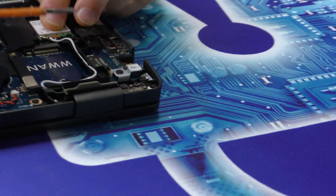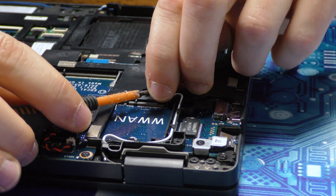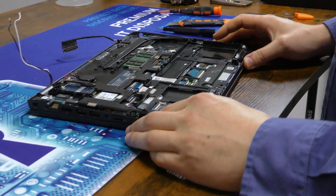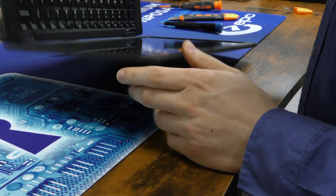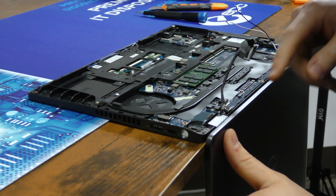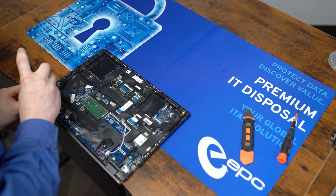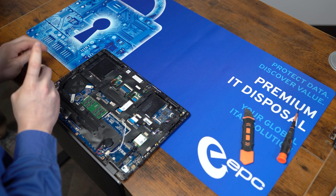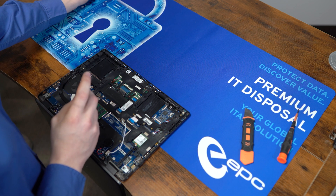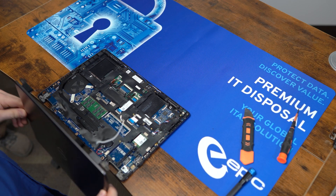You'll have to disconnect the Wi-Fi cables — be very careful, just apply pressure directly underneath. Now let's go ahead and remove the lid. What I'm going to do here is open up the device, flip it around, and then set it right on the edge of the table. It's best not to put too much pressure on these hinges, so this way we can alleviate all that pressure while moving it straight up once we remove the screws. It's just two screws on either side. These screws are slightly larger than the other long screws, so make sure not to get them mixed up. It comes right off.